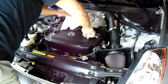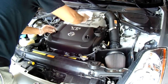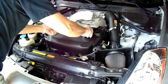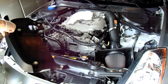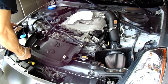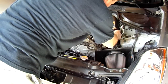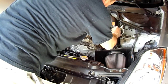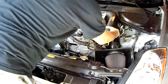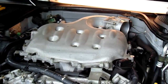After you get all the screws loose on the intake, you can go ahead and take your engine cover off — it's just four bolts, very easy. Just place that to the side. Then take the intake tubing apart. There's a piece of tubing that comes from the valve cover and runs to the intake tube that you'll have to disconnect. Just pop that loose and set it aside.